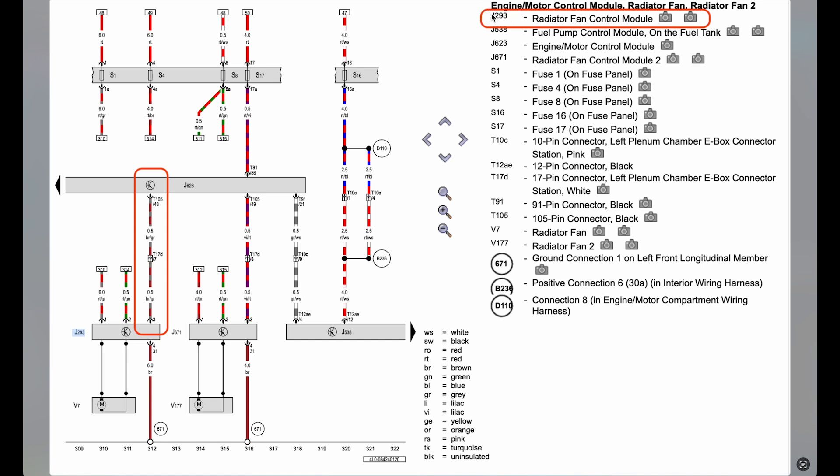Getting into it, the J293 — and also here on the diagram — this is the larger fan on the passenger side. I chose it because it covers most of the transmission cooler that's on the front. I was running into over-temp warnings for the transmission showing on the cluster, and it'll also set a fault for clutch lockup temperature too high. So in an effort to bring those temps down, I'll set it to max speed if I know I'm working it hard. You can see J671 here — he is the smaller one on the driver side. I left him alone; it wasn't necessary for my situation.